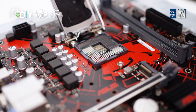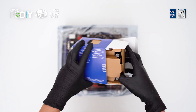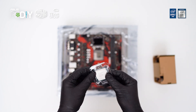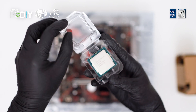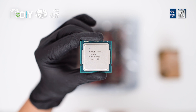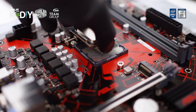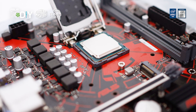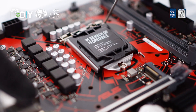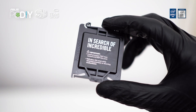Unclip and lift up the socket cover. Next, we unbox the Intel 10th Gen Core i5-10400F CPU. Gently remove the CPU from its cover by holding the edges. Notice the tiny little triangle on the lower left — we will align it in the same orientation as the small triangle on the CPU socket. Gently drop the CPU onto the socket; no force is needed. Once the CPU is on its socket, close the cover and push down the pin to secure it. The plastic cover will pop off — remove it and be sure to keep it in case of a warranty claim.